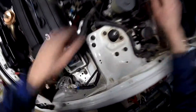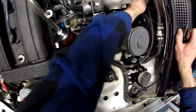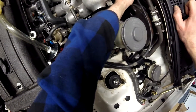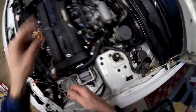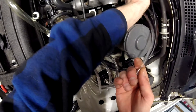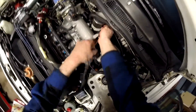I also took the cruise control out of this car, and I was looking for a way to get the vacuum line to the interior. I remembered there was a hole here where the cruise control throttle cable was. This should come up right above the pedals — there we go, it's going in there now.